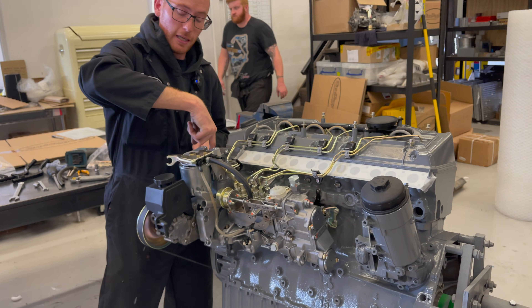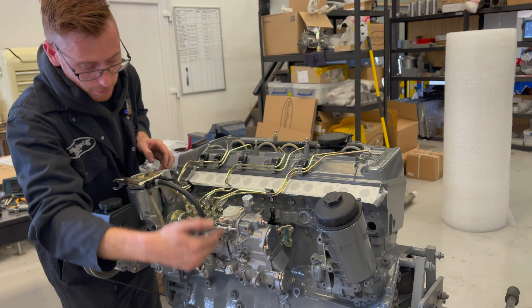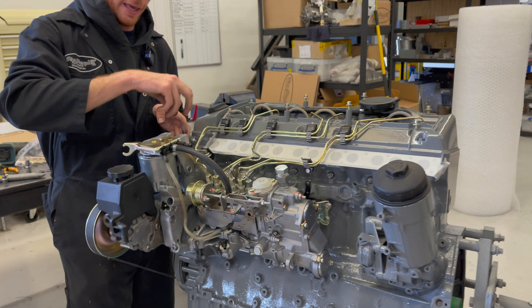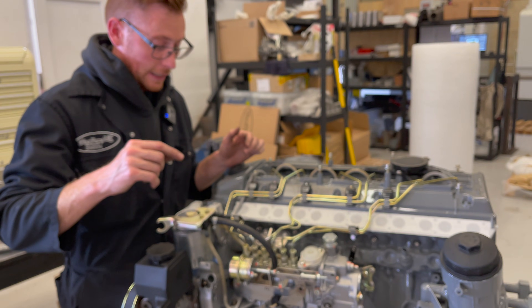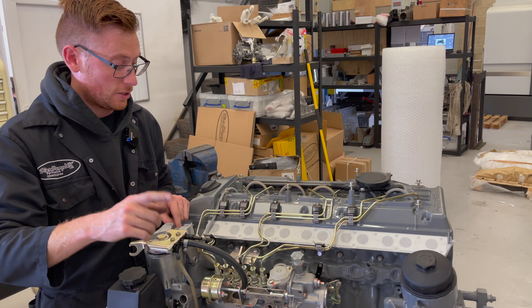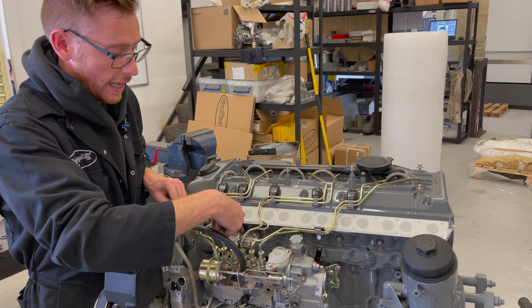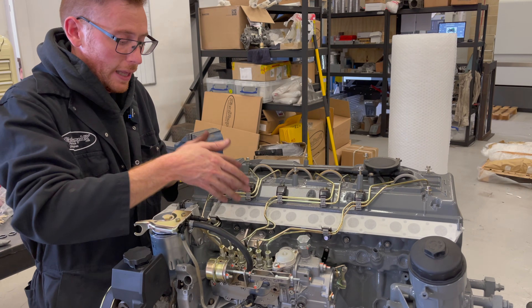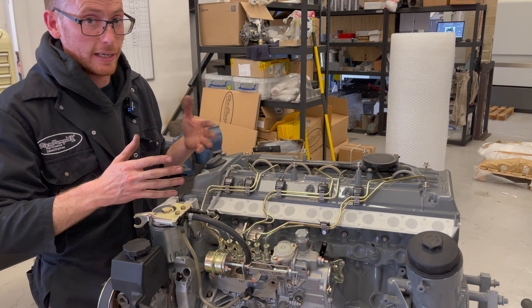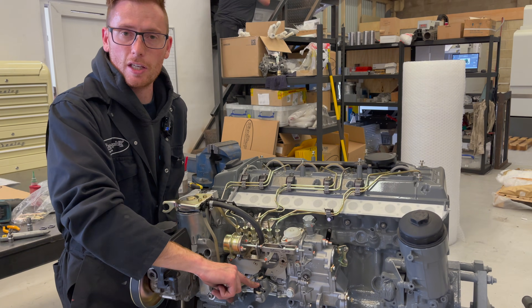You do not need the pre-filter. That is a problem area because it would normally be attached before the lift pump, causing vacuum issues and all sorts of breakdowns. Literally take the 10mm bolt out of there, pull it out, and throw it straight in the bin. Also, the other bit you want to throw away to keep this all nice and simple is the original preheater in the head. The diesel would have come through into the preheater, but you don't want that — it's another place where you can have air ingress or a vacuum leak. We want to get rid of as much of that kind of complication as possible. So all you want is the pipe from the tank to there, and that is the only place you can get air ingress or a vacuum leak.